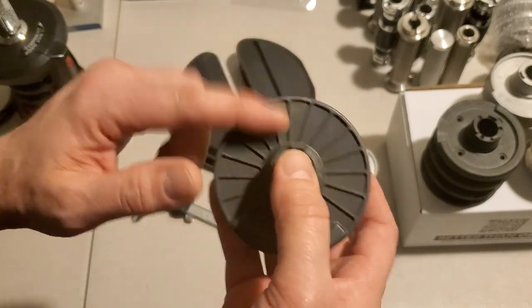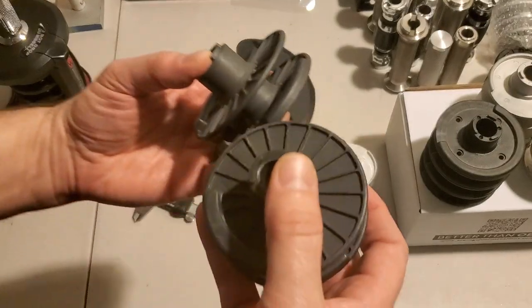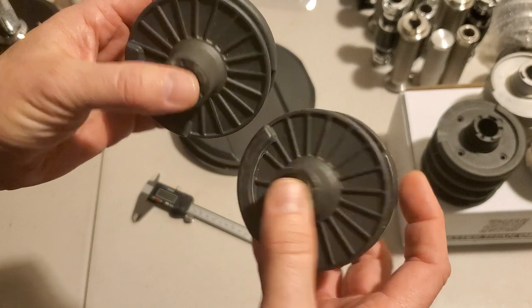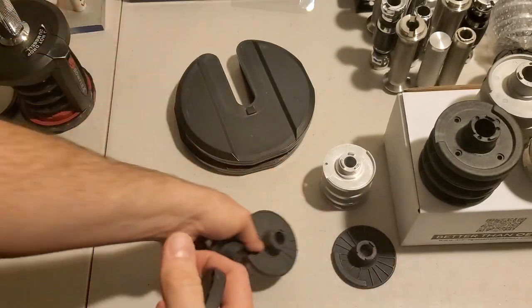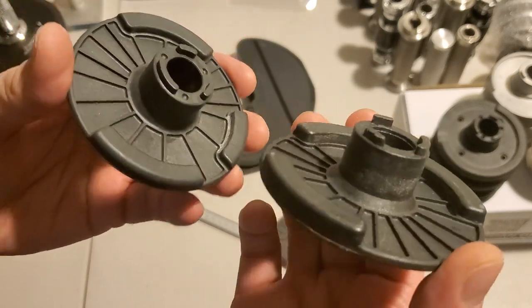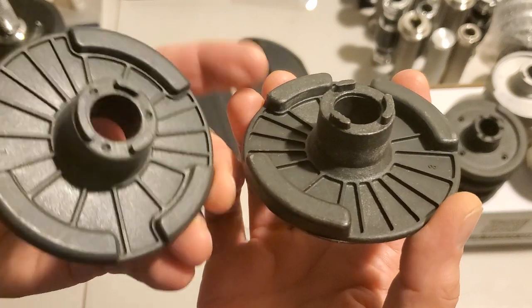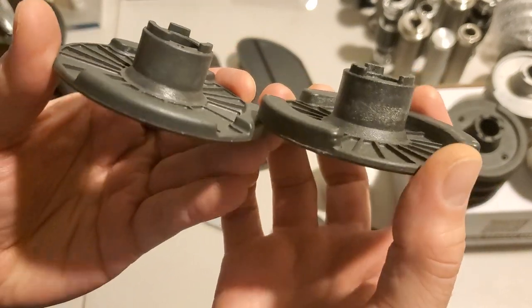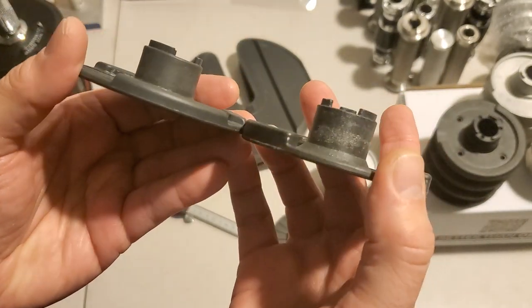What I've got here is a 552 Series 1 portion of a disc pack — this is disc three and four — and I've got another one here, disc three and four. They basically look like the same discs from a 552 Series 1, but they're not. What is immediately noticeable here is the height of the lips. You can see the disc on the right side has a noticeably taller lip and noticeably taller height than the disc on the left.